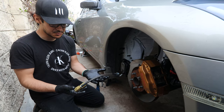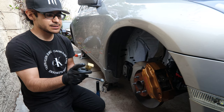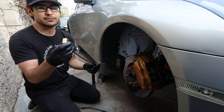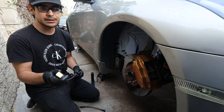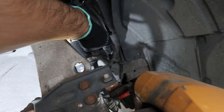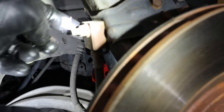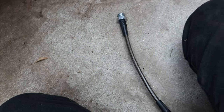For the front there are two pieces, so it's a little different than the rear. The key thing to pay attention to is making sure everything goes on loose and free — make sure everything fits where it's supposed to before you tighten, because you do risk a lot with brake lines if you don't install them correctly. Use the flare wrench on this bolt, then remove the clip, go around the coilover, remove that 10mm, and then there's a banjo bolt behind it. From there you remove the old lines and put in the new ones.